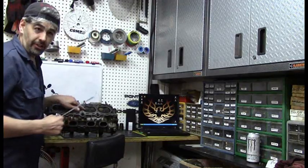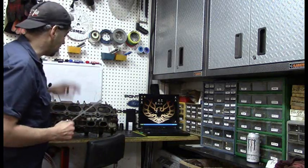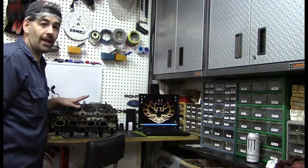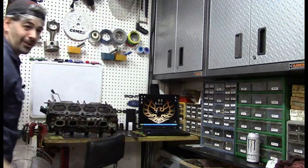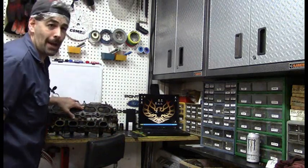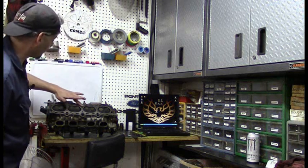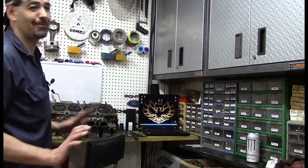This is the reason why you don't just fix a blown cylinder head gasket by replacing the gasket. If we put this cylinder head back onto the engine with a new gasket, the instant we started the car the new gasket would fail because of such warpage. I remember taking a cylinder head that was out of spec by about three thousandths to a machine shop, and the guy just ran his finger and said 'right here, probably about two or three thousandths.' He just felt it with his finger — absolutely amazing. I definitely recommend getting the feeler gauge.